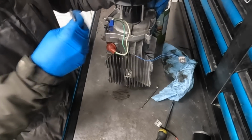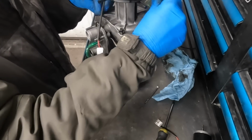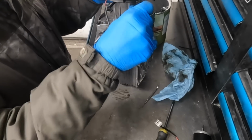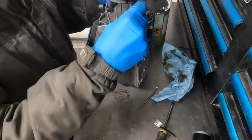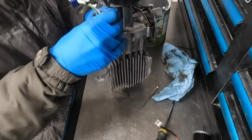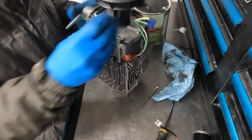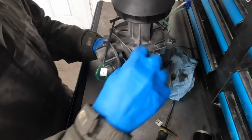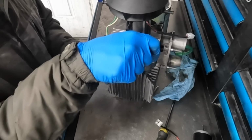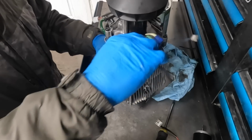So we grab our 4mm Allen key, spin these bolts back in. Multitask and spin one bolt in with the Allen key and one in with your fingers, just to speed up the process. Just like that. Again, you want to make sure these bolts are tight, but not so tight that you strip them out. They are fairly small bolts, and aluminum isn't the hardest material, so be careful not to strip them out.